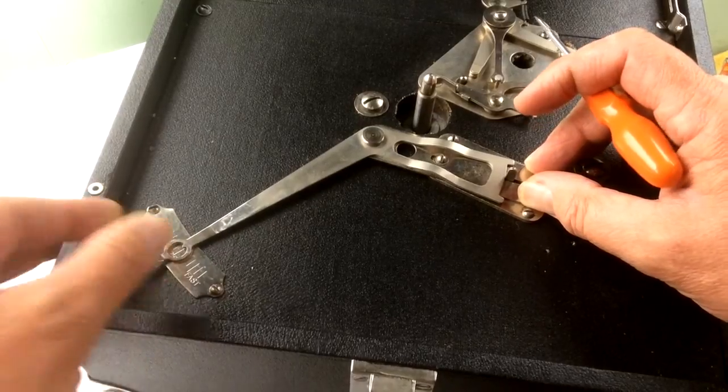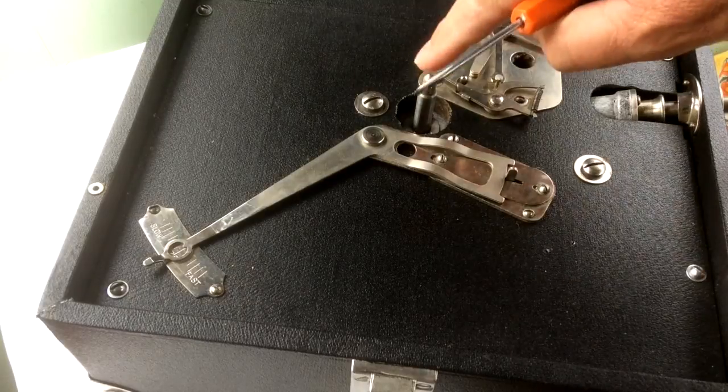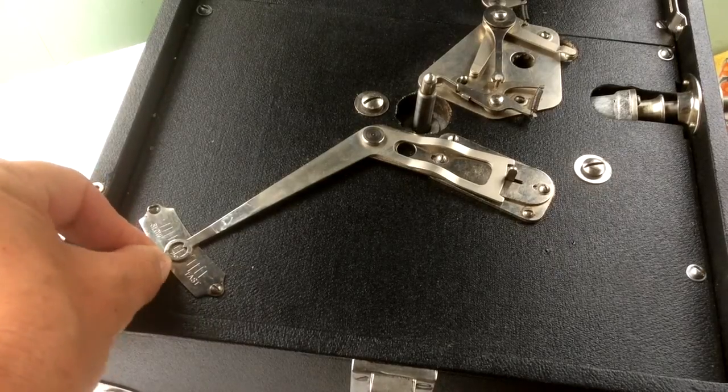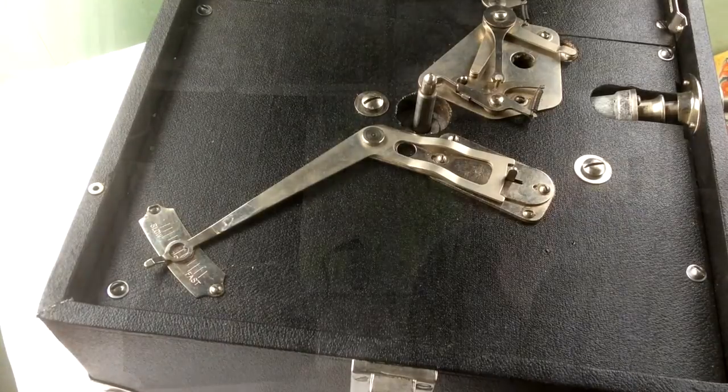So as you can see, it's a system of trial and error, but eventually you will arrive at the speed there being approximately to what it is there. As I've said before, 78, 79 RPM I'm fine with at that point. When I've got the record on and it's on the turntable and the sound box on, there may be a little bit of drag, although I don't find there's too much more than a revolution or so, and that can easily be taken up by a slight movement there if you're that particular about the speed.